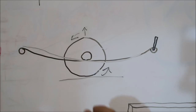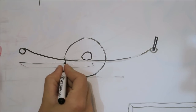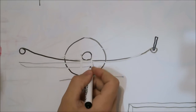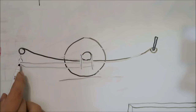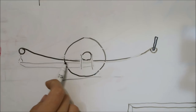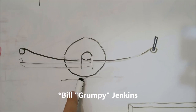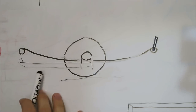The thing to do is get some sort of traction bar — in this case a very simple piece of steel that bolts right around the axle. These are also called slapper bars, and here's why: as you hit the gas and the tire gets grip and wants to twist the spring, the front of the bar comes up and physically makes contact — or slaps — the eye of the spring, giving it mechanical leverage so the spring physically cannot twist. This is a super old-school design from around the 60s — I think it was Don Garlits. It basically just fights wheel hop. For actual traction improvement you'd want Caltracks or Assassin traction bars.